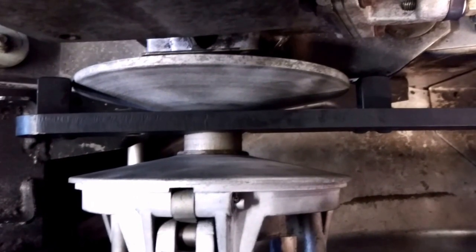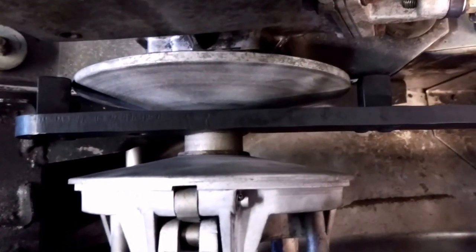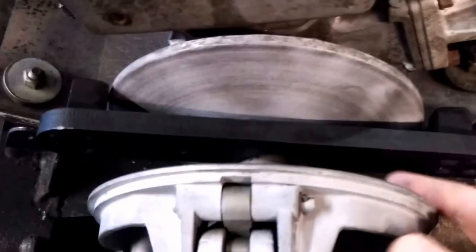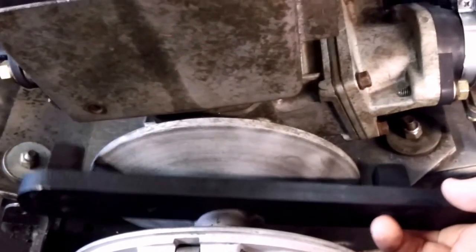When I do this, I normally just try to place the engine mounting bolts back where they were, but in this case, as you can see, that did not work well for me. There's a big gap on this side, and you can also see the tool is not actually down on the shaft here. There's a big gap here where the opening is for the clutch.